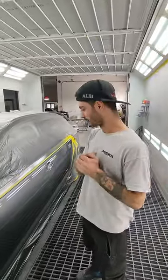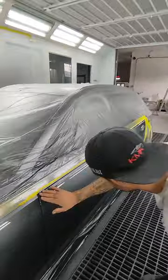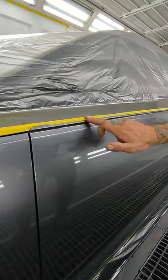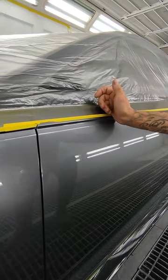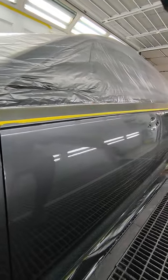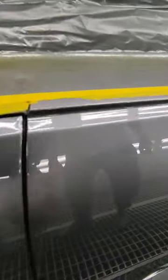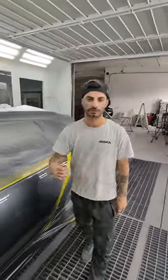The car is painted and I'm going to show you the final result. Remember I put two fold tapes — when I finished with the paint I took off the second fold tape, and when I was done with the clear coat I took off the first fold tape. As you can see the line is perfectly clean. Nice and clean — try this one out!